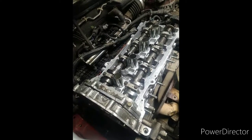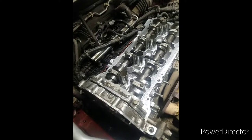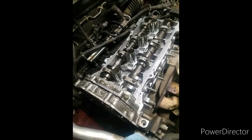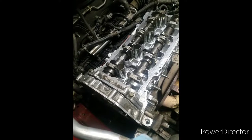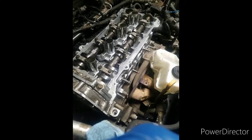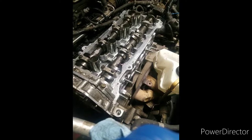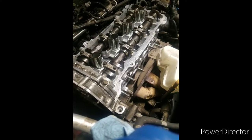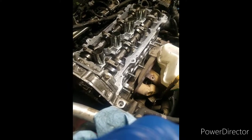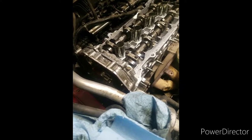Honda don't do it. Honda is the one that has most of the engines with the coolant around the cylinders like that. I didn't enjoy that part. It really made me mad, because if I was designing a motor, I would have known better than that, because the mating surface for each piston is so small. When we sit here talking about mating surface with the head gasket, it's too small. You're going to run into this issue again. This is why they keep blowing. I bet you if you get this just a little bit warm, the head will warp, and that's a wrap every single time.